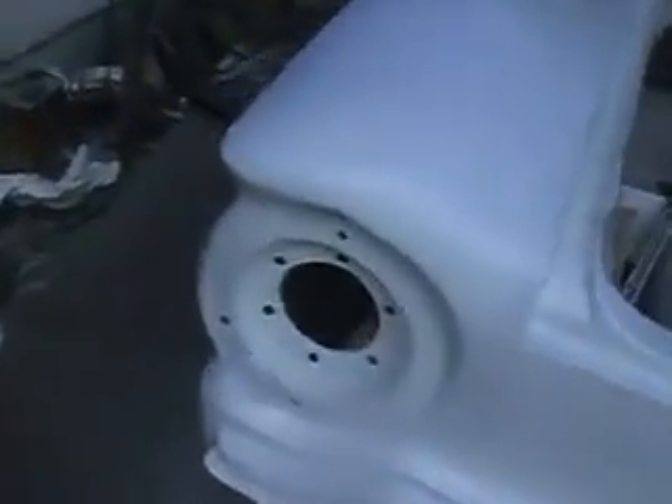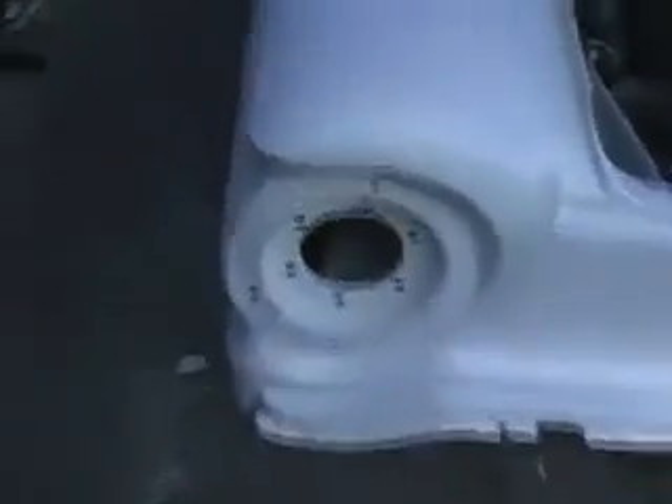I'm up to this side of the fender — this one's got what looks like a dent in it, but this other one is nice and smooth, so I've got a little work to do on that. Along this side I've got a guide coat of primer on all my Bondo down here on the wheel. I don't think there's too many dents in this door. I did this front fender — it's like the final skim coat of Bondo on it. Basically I've got a rear fender and a door to do.